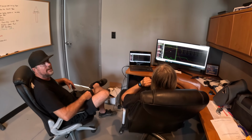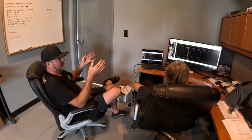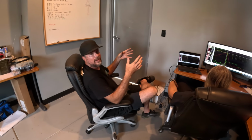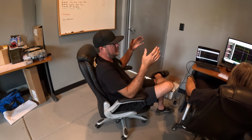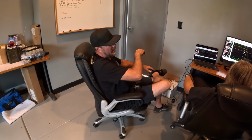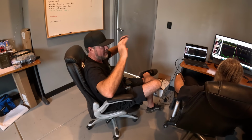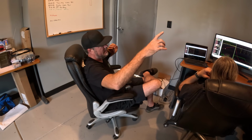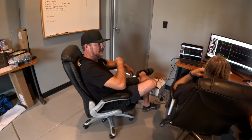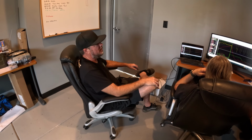Essentially, what a dyno is doing is measuring the amount of time it takes us to accelerate the roller. So it's work over time, and that's how you extrapolate horsepower and torque numbers. In the middle of our accelerating the drum under the back tires, the tires slipped, the drum slowed down, then the tires grabbed and the drum sped up. And so the end result is it says we made 990 horsepower, when really it probably made more than that.